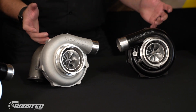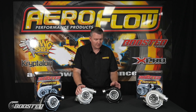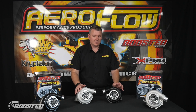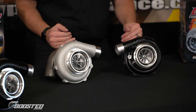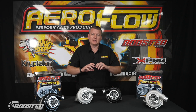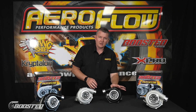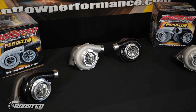From a technical and physical standpoint, those are basically the features between the two turbos. They are similar — the key difference is that the turbine on the 6262 is a 62mm turbine, whereas the 6255 has a 55mm turbine. Both are nine-blade, both have a nine-blade 62mm compressor, and both share the same construction. In terms of where these sit in the broader market, you would compare them to a G35 and G30 style turbocharger respectively, which gives you a good idea of where they're rated.